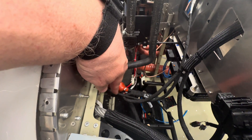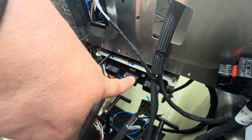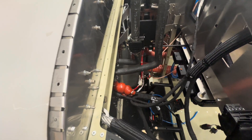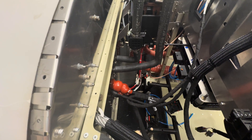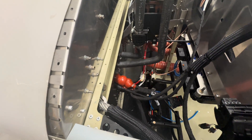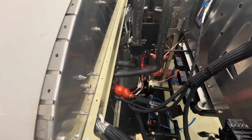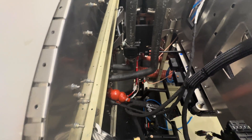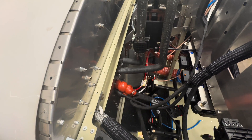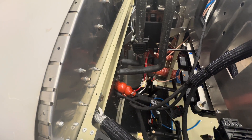These are the Rotax fittings or connections that come to the Rotax ECU here. I sort of tripled up on the wrapping with some fire sleeve around those fittings just to kind of fill that hole — I decided that was easier. I made it really fat and crammed it in there, and that filled the hole for the most part. I have some high-temperature fire caulk sealant that I'll pump in there once I'm happy that I'm not going to have to change anything.